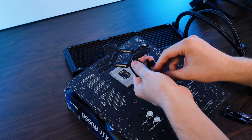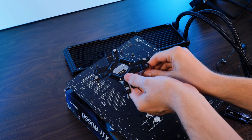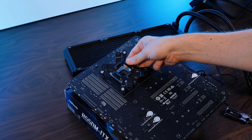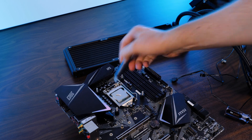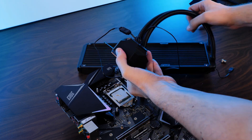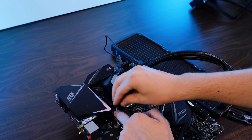Over on Intel's side, it's a bit more complicated. We first need to take the Intel backplate and shove the Intel screws through the appropriate holes, then fixate them with the plastic washer on the other side. If you're unsure which hole to use, just place the bracket behind your motherboard and look through the holes. Once the backplate is positioned, place the Intel spaceholders on top of the out-sticking screws, splash some thermal paste onto the CPU, prepare the water block by shoving the retention bracket with screw holes on each corner into it, place it on top and screw each side down with the spring screw. Just don't forget to hook up all of the RGB connections and fans too.